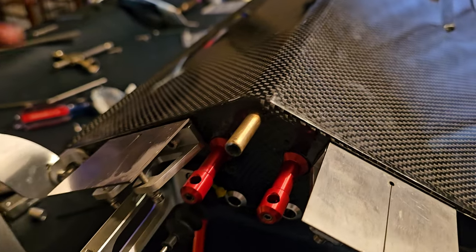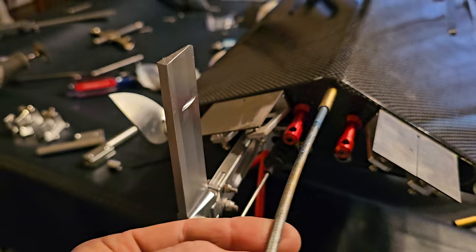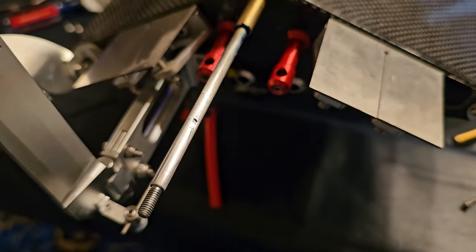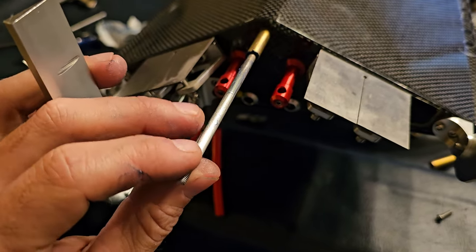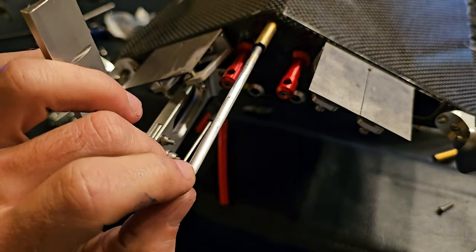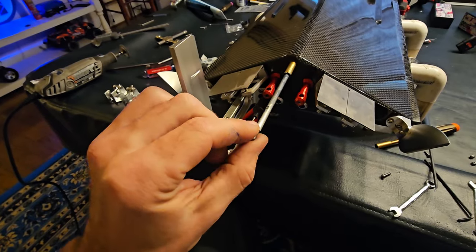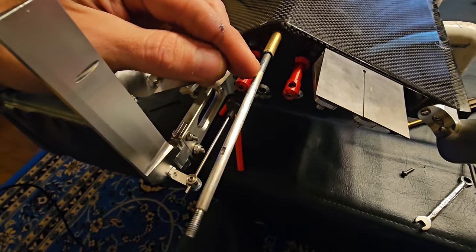What I was thinking about doing is taking the stuffing tube and cutting it about right here, and I'll show you why. I've already cut this tube — it used to stop about right here. The reason I cut it was because I realized the flex shaft doesn't do its job if when you try to trim and move it, the flex part isn't showing. If you slide the shaft out about a half inch and give it adjustable trim, the flex shaft can take that abuse. On Ironclad's video, his shaft cracked right at the weld where they weld the solid shaft to the flex shaft.